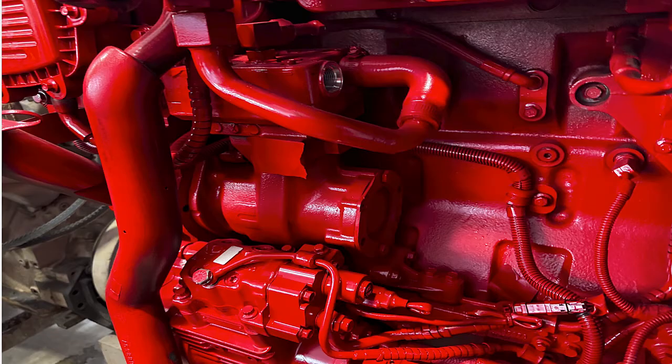On the new engines, you'll see on the turbocharger compressor housing a new fitting off of the housing towards the engine block. It goes to the front, to a bracket on the front of the engine, and then across through that bracket — air through the bracket — and then there's a pipe on the driver's side with a tube that comes back, going over to a hose that goes into the air compressor. They did that so the air compressor only gets clean, turbocharged, filtered air, solving the soot problem. It took some extra plumbing and a housing change on the front of the engine. When you see those extra pipes going up off the turbo to the front of the engine, that's what they're for — the air compressor inlet air.